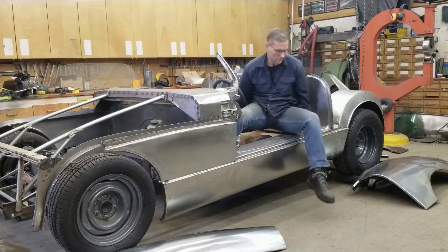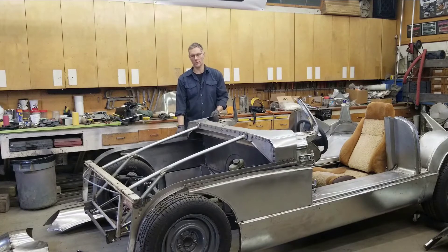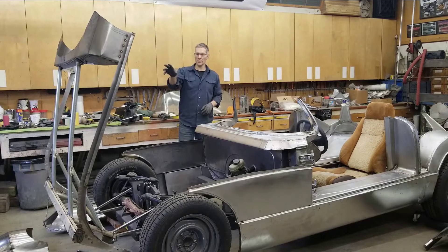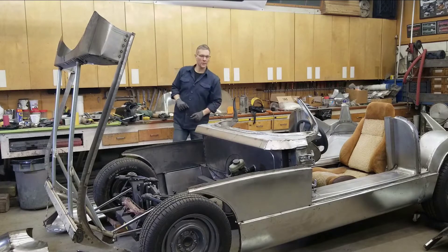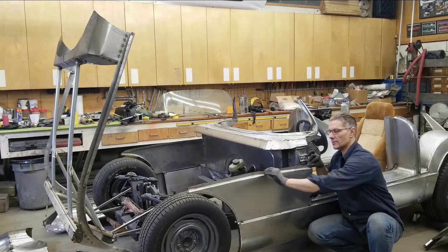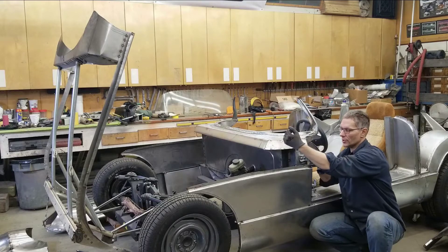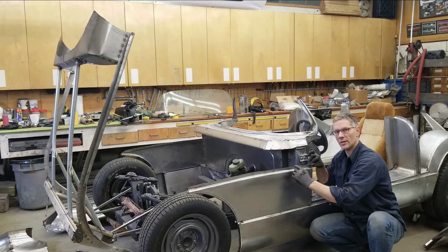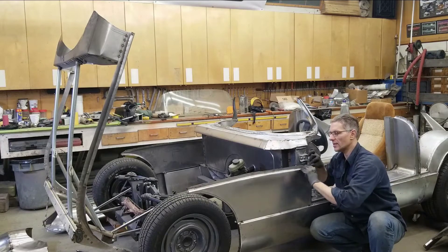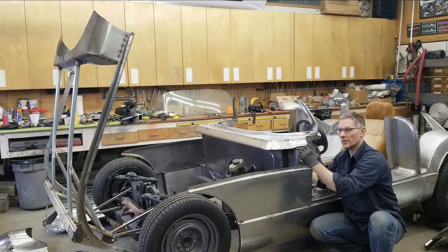Now to get out of this car. We've got all the panels laid out around the car and we're going to start with the assembly at the back. I just wanted to show you the front clamshell structure and how it opens up. We've got all the stops built in — the two fender sides, the hood center section, and the whole front fascia will all be one piece and open up towards the front. In one of the earlier videos I showed how we hand-formed this fender feature here, which is part of the clamshell, so that when it comes down it interfaces with the side panel in such a way that you don't have daylight shining through. When you look from the side of the car and look between the gap, you won't see daylight into the motor compartment — just a nice, consistent gap because of this return.